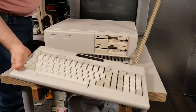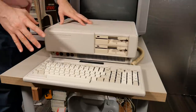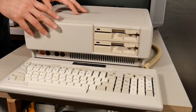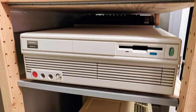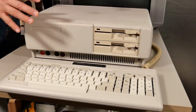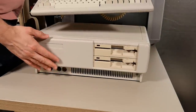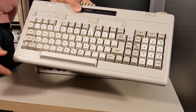Fortunately I found the keyboard that matches this particular computer. As far as I'm aware this keyboard works with the Tandy 1000, the 1000 A, and the 1000 SX — possibly the TX as well. Some of the later Tandy machines like the Tandy 1000 TL work with regular XT or AT keyboards, so a standard keyboard does work with those. For whatever reason Tandy decided to use a different keyboard protocol for the way the keyboard talks to this machine, rendering any other keyboard unusable.